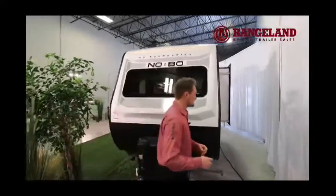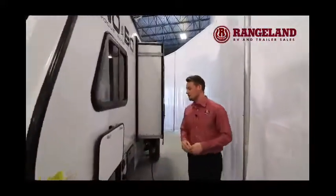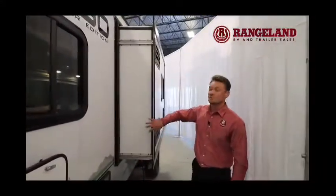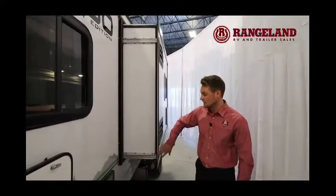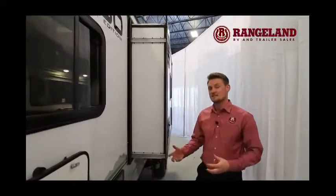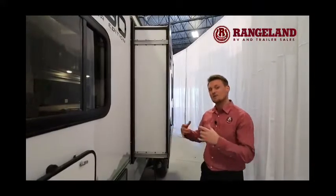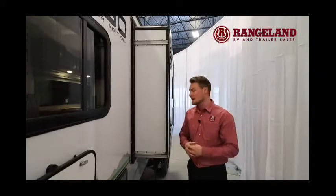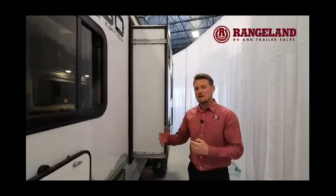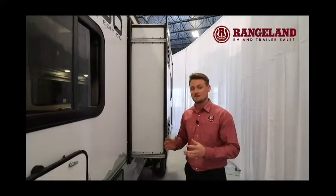Follow me through this way, we'll look at some of the exterior features on here and continue to talk a little bit about the construction. For an example, on this particular side of the trailer, you'll see it's got a beautiful Schwintek slide out on this floor plan. And when I say Schwintek, this is actually a four corner gear track system. So it's really nice because it pulls that slide in and pushes it out equally on all four points. The other thing that is really nice about this Schwintek is if it ever comes out of alignment, you can simply bring it in and out two or three times and it'll help auto correct itself.